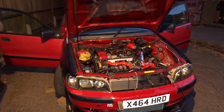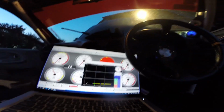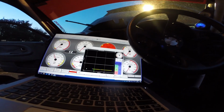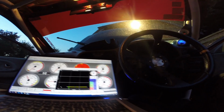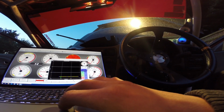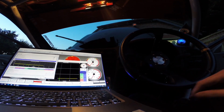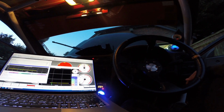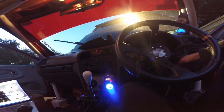That's disappointing. Let me have another think. So here we go. I have just hopefully figured out how to do this. We have to repin the fuel pump. Yeah, that's what I had to do. Right, I've just had to repin the fuel pump, so the standalone ECU is controlling the fuel pump. So when I prime now, go start up, cranking settings, I've got 120 seconds on the fuel prime, so that now primes up and stays on, and hopefully this is going to work. We shall see.